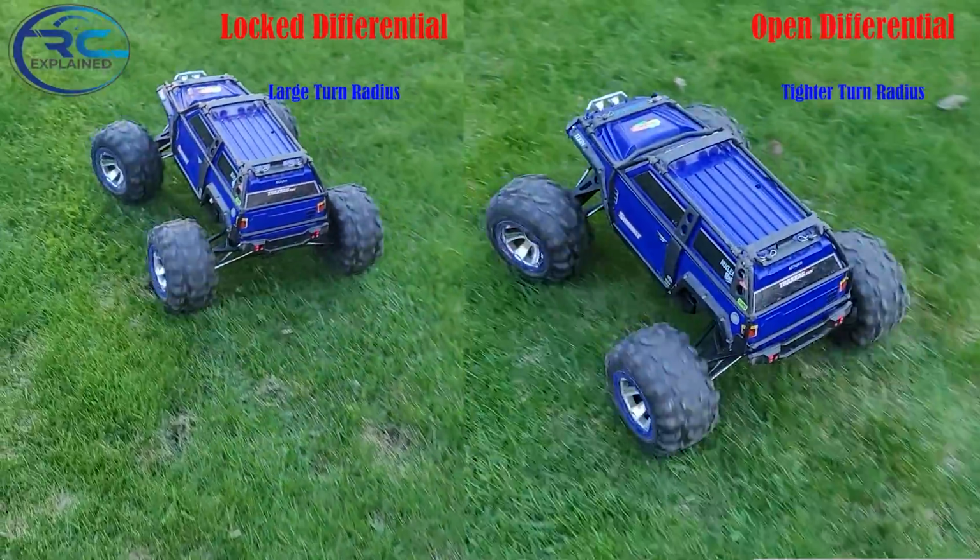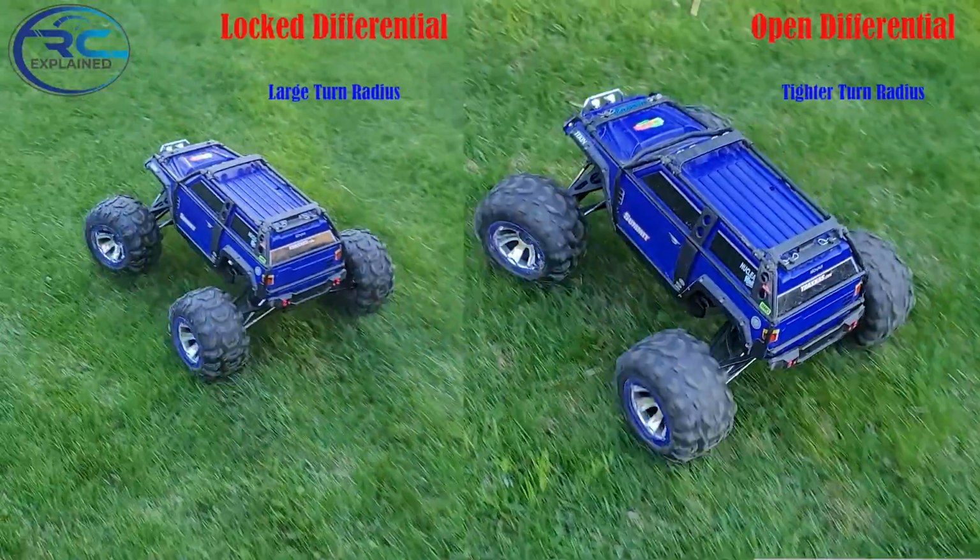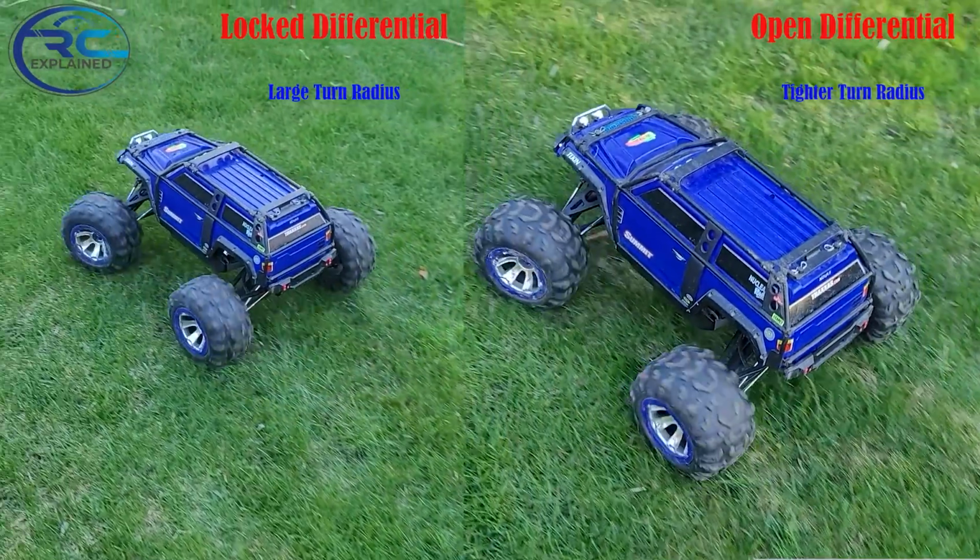If we are looking at the advantage of locking the front end, this is going to help improve the traction on those two front tires. And the same applies for the rear end. If we lock the rear differential, we're going to see power delivery quite evenly between the left and the right rear tires. Now, there's a very limited number of cases where this would be beneficial for you.